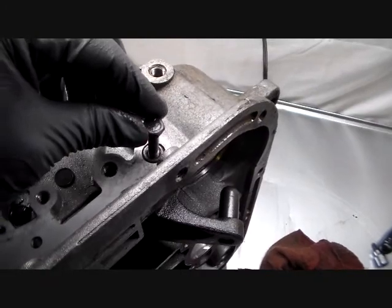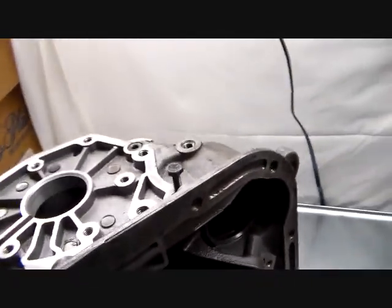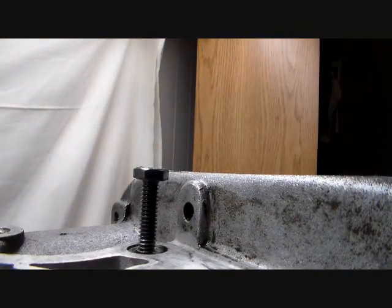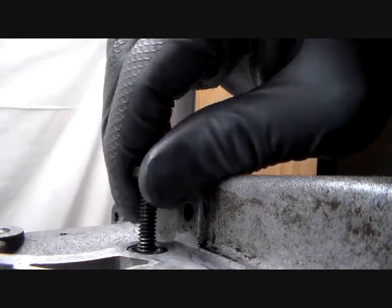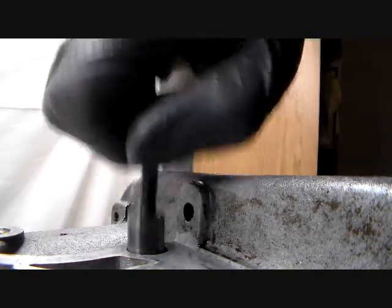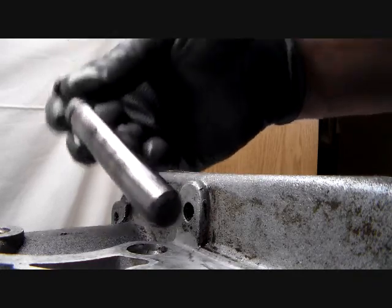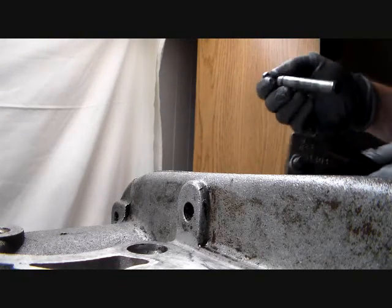She gave me a great tip: take one of the valve body bolts, lightly screw it in, and this pin should come right out. I'm going to hold the lever with my other hand so it doesn't go flying, and then pull this thing out. Hopefully it comes out easy — it's got one O-ring on it. There we go, and then we pull the lever out just like that.